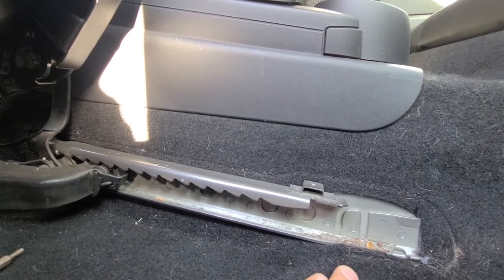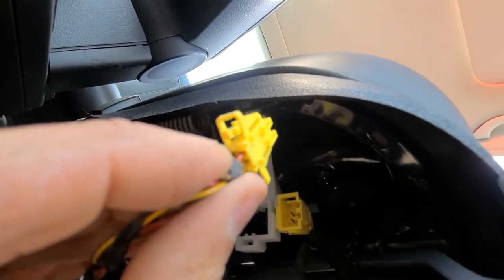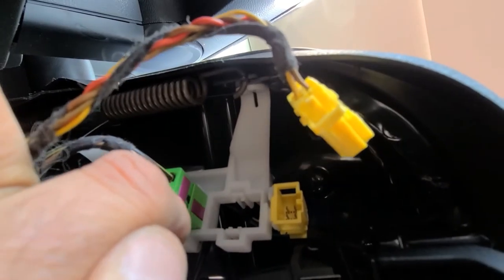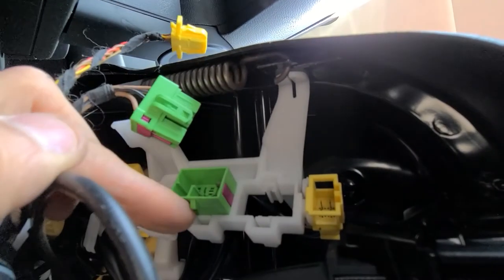Once you do that, you'll have to disconnect the airbag wires and then you can remove the seat. The seat is now completely loose. You'll see two connections up here which have to be disconnected, and once you disconnect these wires there is nothing else holding the seat. The small yellow one — just press on the two small clips and pull it out. The green one — lift this green piece and unplug it; the green clip just has to go over this small knob.